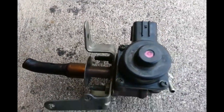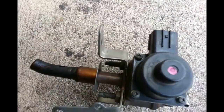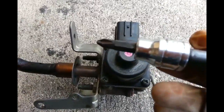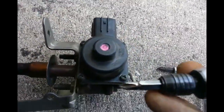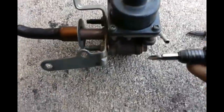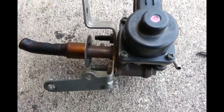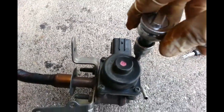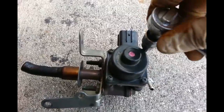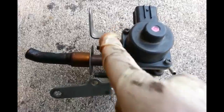To avoid stripping these bolts, my best advice is to get a proper impact driver or similar tool, because if you use a regular flat head screwdriver, you're very likely gonna strip them and won't be able to open it. Get something like this and press down hard when you unscrew them - that's why you don't strip them.